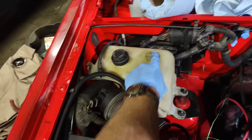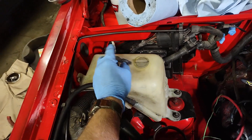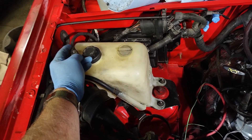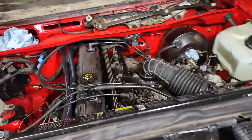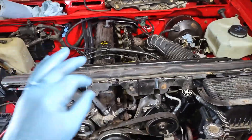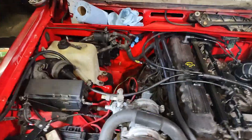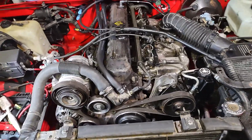The bottle from Hippo did not have the coolant level sensor — I'm going to have to pick one of those up from the junkyard. I have the plug to it, which is odd because this is the harness from Hippo. But I think it just goes to the VIC, Vehicle Information Center, underneath the dash, and it really doesn't mean anything. My 93 Limited — I took the VIC out because it was screwed up and causing electrical problems. I've actually found a ZJ at a pull-apart place in Arizona that had the pocket in the dash instead of the VIC, right below the climate controller. Some of the harnesses are made separate, some are made the same, to wire for things even if they're not going to put it in.